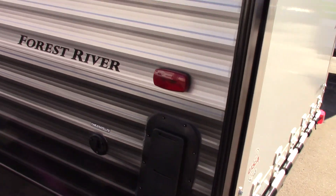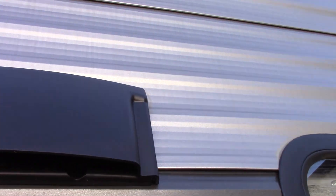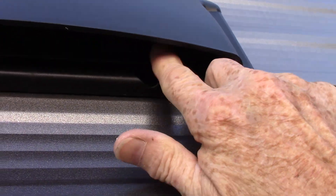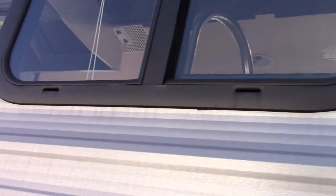That is a vent for your garage. Coming back this way, this is the vent for the range hood. When you run the range hood fan, you always want to open this up so it flaps freely — there's a baffle here that needs to flap freely so it vents to the outside. Otherwise, just keep it shut.